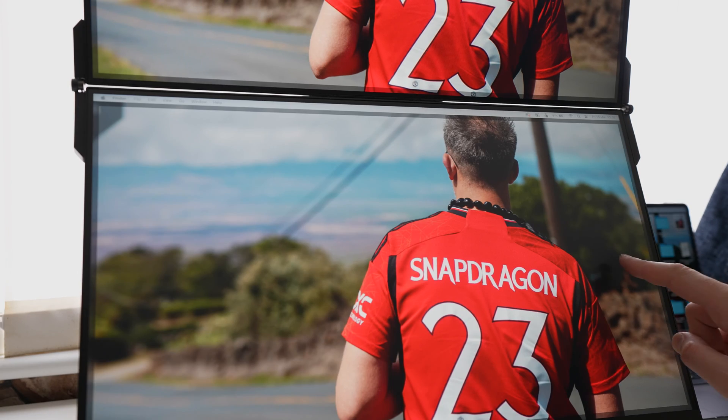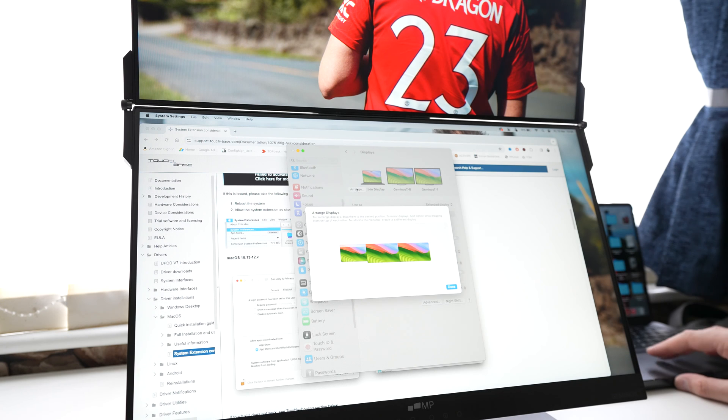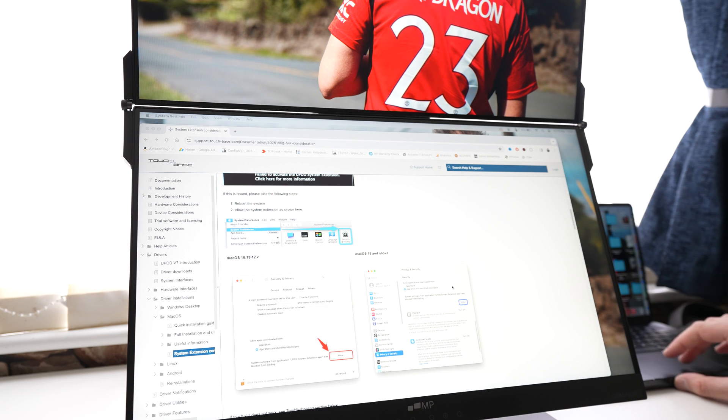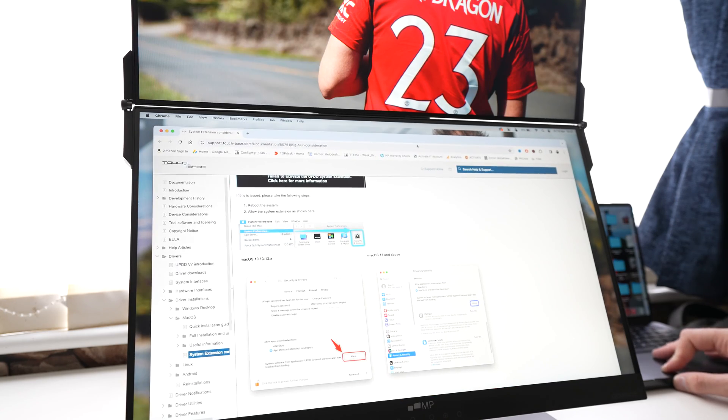Accessibility — those need to be turned on. I'm having a little bit of a battle getting the UPDD system extension working. I think Apple is quite secured and locked down. We have to come into privacy and security and click allow, then put your password in. We do have touch activated at the moment, which is great. Let's click arrange. We have the built-in display — that's the Mac. Let's see — flashing red there. We want to put that one at the top, that one at the bottom, and put the Mac at the bottom as well. Now if I move up, I can drag straight up to the top. Nice one.